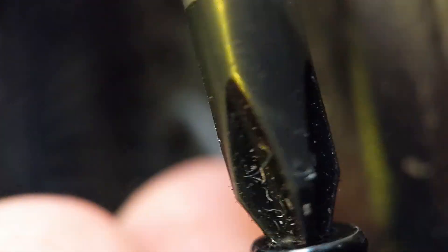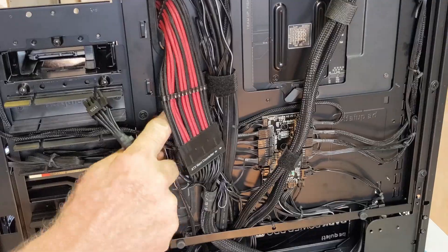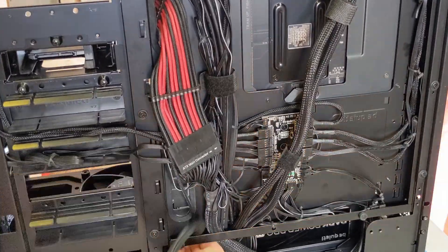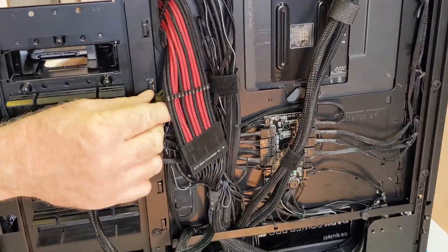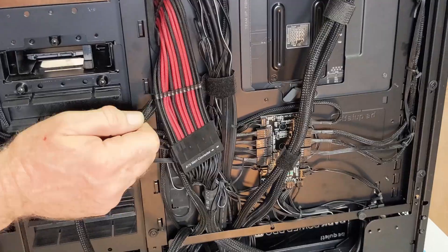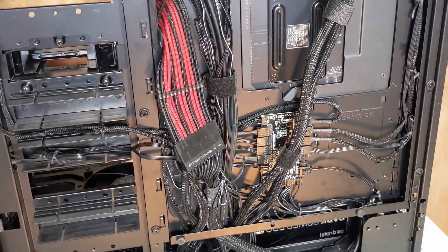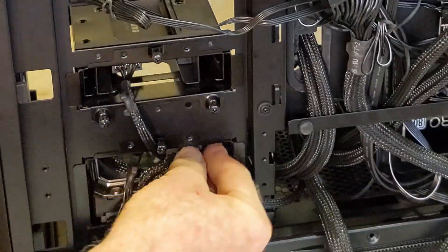These are the GPU cables coming out from the PSU compartment. Notice how I fished them through the raceway — your case may be different, but many will have places designed to pass cables through, allowing you to close the case easily afterwards. Do the same for the CPU cables and the 24-pin motherboard cable. In general, the smaller cables will go under the larger cables. I use both hands to find a good spot to pass through the rubber grommet to get to the graphics card. When attaching SATA connectors to the drives, check the keyway orientation. Manage the cables as you go along and have fun.